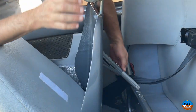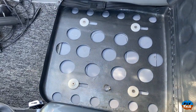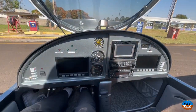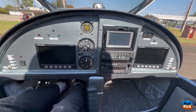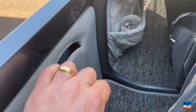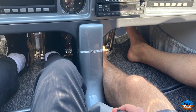Seat backs are adjustable in flight. And the distance to the rudder pedals can be adjusted on the ground through this system. You fly the Seamax with your right hand when seated on the left. There's one central stick and a power lever for each occupant. The central stick contributes to the feeling of roominess in the cabin, since there's nothing in the way of your legs.